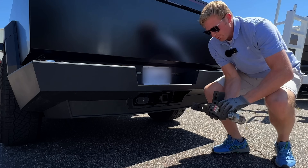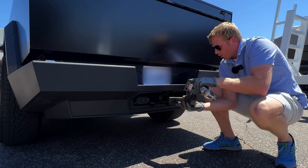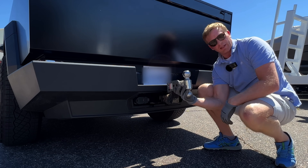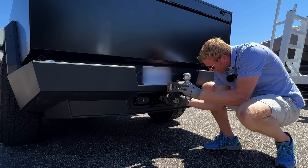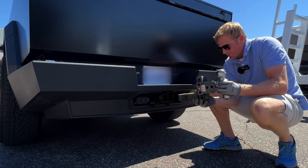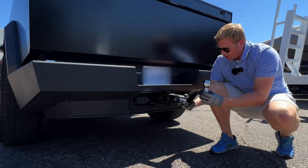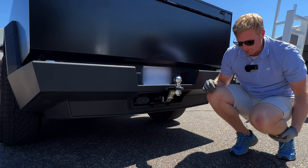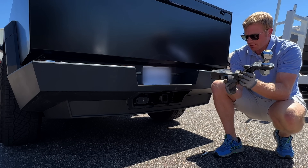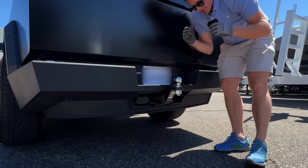Set up this way, it's roughly 8,000 pounds. We ran into a little bit of a problem with the Cybertruck. We were wanting to use this adjustable hitch by B&W, but we can't hook it in — the pinhole and the bumper knock against each other. So adjustable hitches won't work; they'll need an extension or something else. Also, the riser hitch is crazy sloppy. I have a couple of fixes — some sleeves that butt up against it to reduce the sloppiness. Still sloppy, just not as sloppy as before.